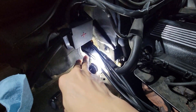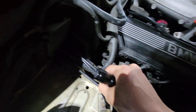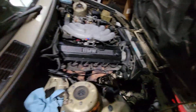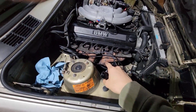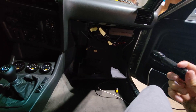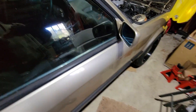There was a boot for the ECU cable originally right there, but I removed that so I was able to easily put the boost line and both the oil and wideband cables through. I haven't connected the oil or wideband yet because I just want to see this run on the base map with the intake air temperature sensor, everything else being stock. From there I should be able to start making adjustments, put in the wideband, put in the throttle position sensor which is somewhere in China right now. I have not had the chance to boot up TunerStudio yet, but I will do that in a second.